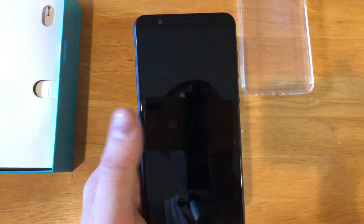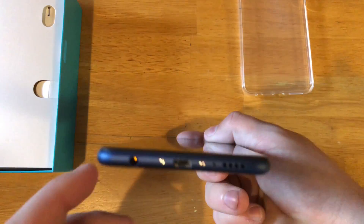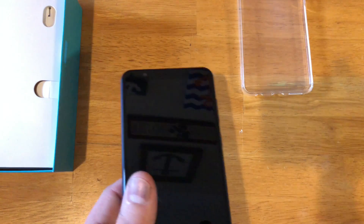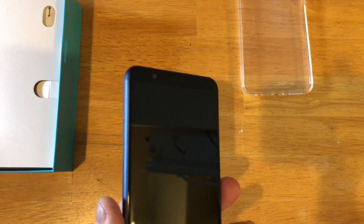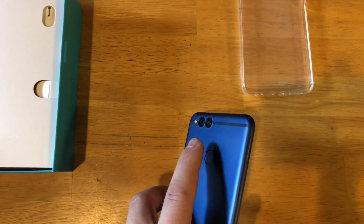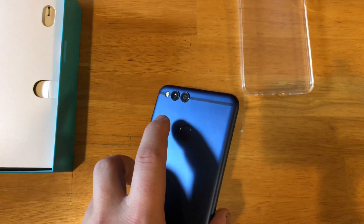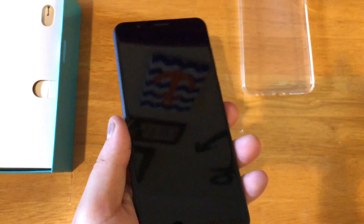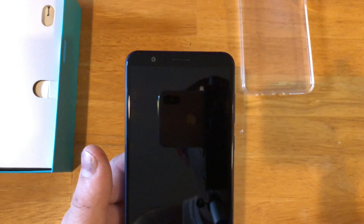Supposedly, this phone was in development for 15 months and they went through a ton of prototypes to achieve this. One thing that will appease a lot of people — there is a 3.5mm headphone jack. Unfortunately, there is no USB Type-C and no NFC chip inside for Android Pay. You will be able to use the bokeh effect with the dual camera setup. The main camera lens is a 16 megapixel lens with an aperture of f/2.2, and the secondary camera is a 2 megapixel camera, meant to shoot exclusively in monochrome. Shooting in low light is not going to be ideal — the aperture just does not open up enough to let sufficient light in dark environments.